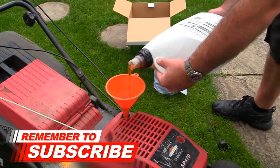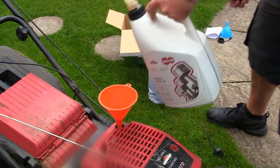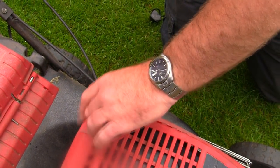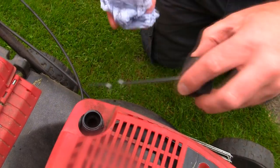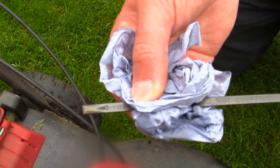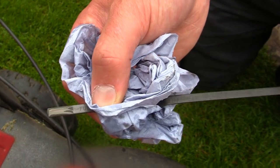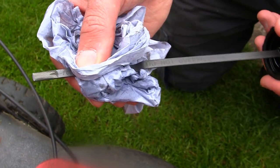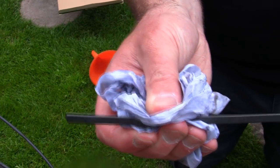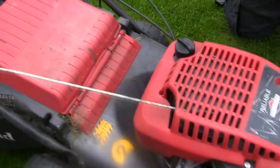I'm going to keep re-measuring this just to make sure we've got the correct amount in. Let's check the oil again and see exactly where we are. You can see on the dipstick we're nearly up to the full line and everything's nice and clean. There's maybe just a little bit too much in there so I'll take a little bit out with the extractor. So I'm just below full there, which is exactly where I want to be — don't overfill these. Everything looks nice and clean and I've done the oil change without having to tip the lawnmower up whatsoever.